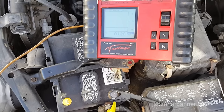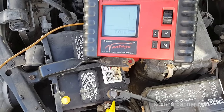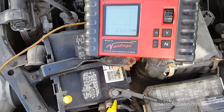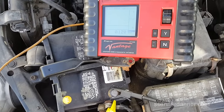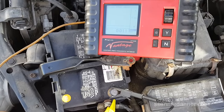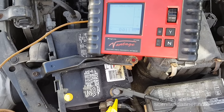No glove box light. This door handle's messed up, Max — the spring popped out. Where are we at, Caleb? 0.016. I'm going to disable the remote start one more time. Just unplugged the remote start again. 0.011 — we're only talking 5 milliamps for that thing. About 6 milliamps — so double what we have.